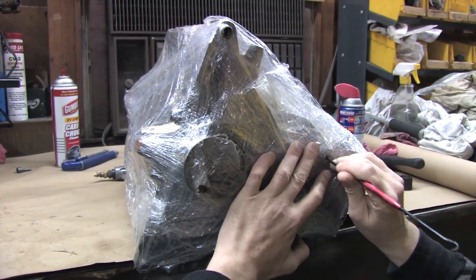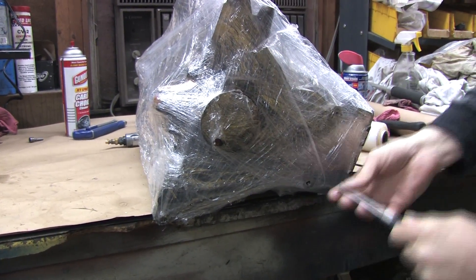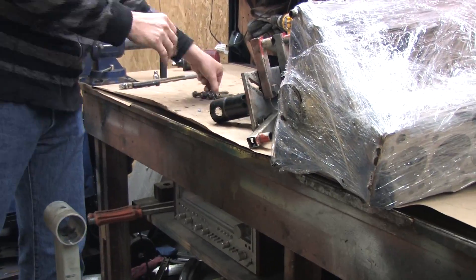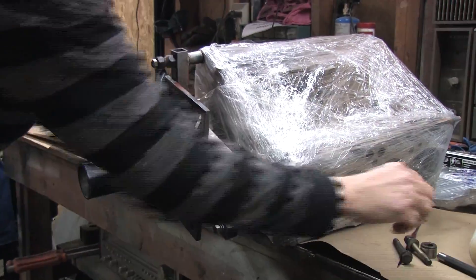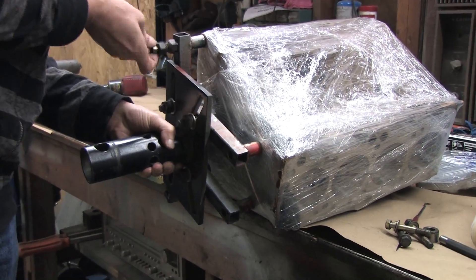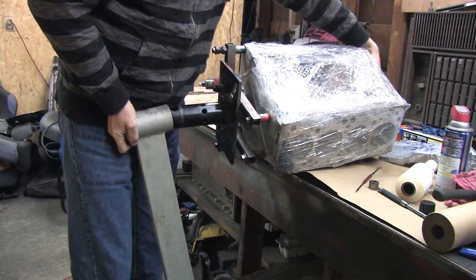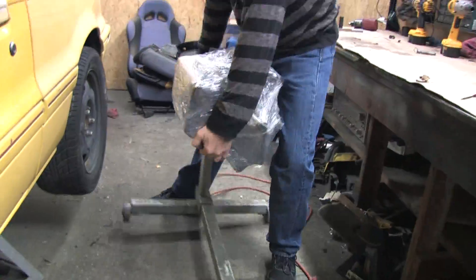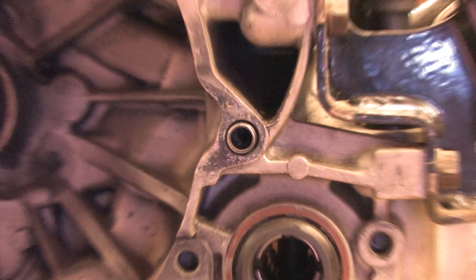This here is a different block than the one we wrapped up earlier. Even though there's nothing wrong with my 7-bolt, I don't feel like using it — I'm not afraid of it. It's just that the parts to replace it are the same ones I'd need to do a 6-bolt swap except for the block itself. I decided to go with the 6-bolt just to be on the safer side for the power I intend to make. I punched the size holes in the block to reuse my JE pistons and bought some custom I-beam rods to fit them. The 6-bolt block has a beefier crankshaft and larger main and rod journals, which tend to make for a more durable bottom end, but I went ahead and added a main bearing girdle for extra insurance. I'm keeping the whole top half 7-bolt to simplify wiring and sensors. These are mistakes I will never repeat — or might not repeat. Now keep this into account.